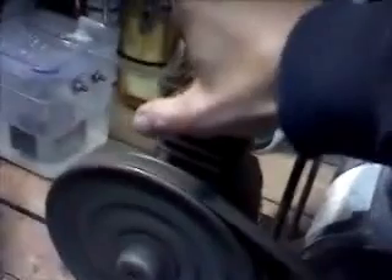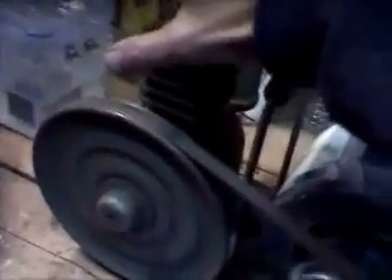Watch what happens when I put my thumb over the vacuum inlet tube. It just gets quiet, and that's all it does. There's virtually no gas escaping on the outlet tube back here because I've blocked the inlet. Also, the motor is not laboring. So it creates the vacuum and it holds it, but it doesn't really have to do a lot of work. So in a real-world application — in an automobile, for instance — once it comes up to vacuum, there's very little power being drawn from the engine.